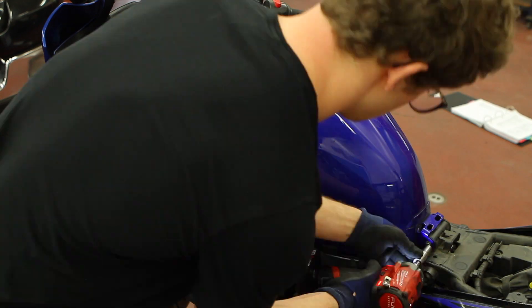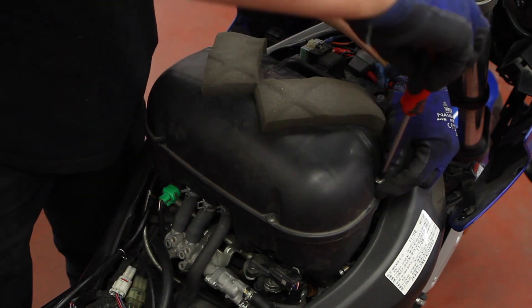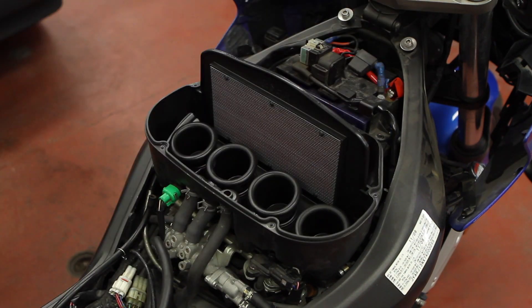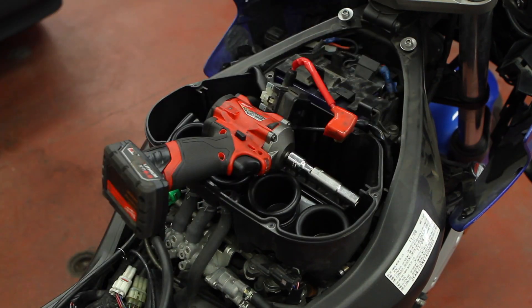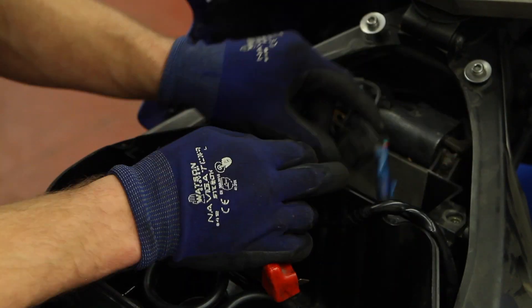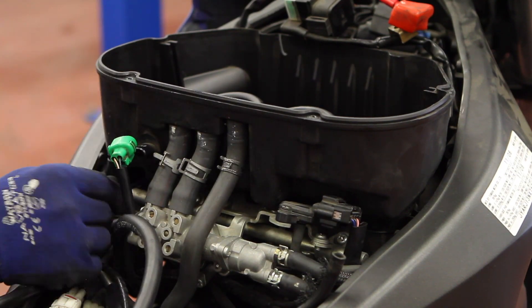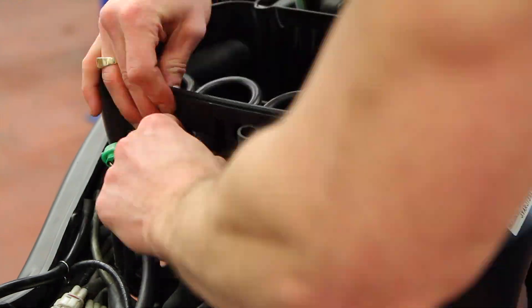Reading straight from the manual, basically what we've got to do is: fuel tank, battery, battery case, air filter, take out the battery box, the throttle bodies, the air cutoff valve, then the radiator — you've got to move your fan out of the way — the ignition coils come off the bottom of where they attach, and then it's just the valve cover and this side cover. I'll have all the tool sizes down in the description, but check out my other videos for details on how to take off the fuel tank, radiator, and air filter.